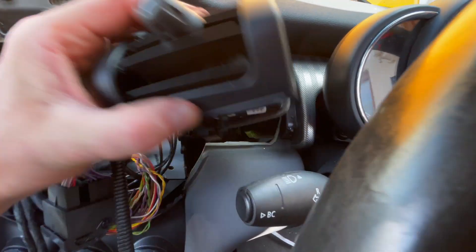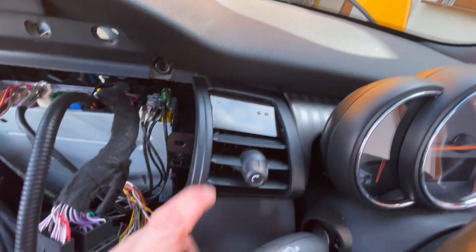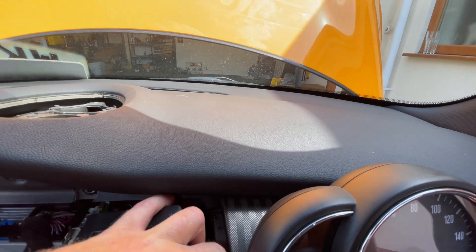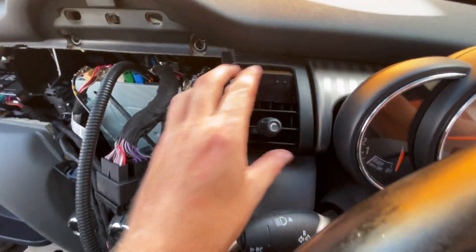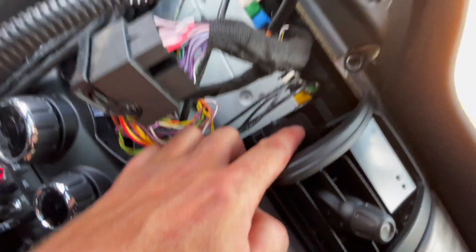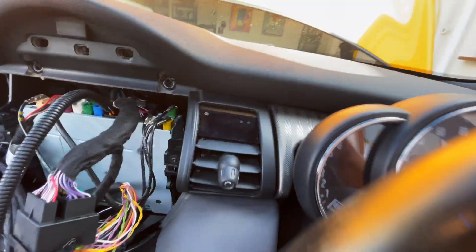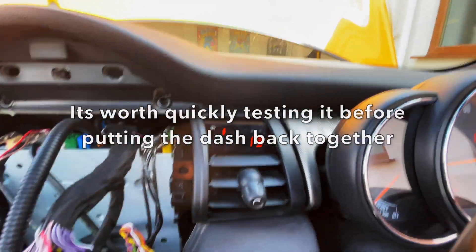You can see we've got that cable down. All we have to do is make sure we overlap the edge, push it back into place so that this lines up here — we come in at this angle and make sure this hooks over the edge of this bit. There are two little pins on this bit of the dash that you push it into. We've got that ready, so put the T20 back in. You can see the grille still works in terms of airflow — good. Then we just reverse the steps to put the screen back in.